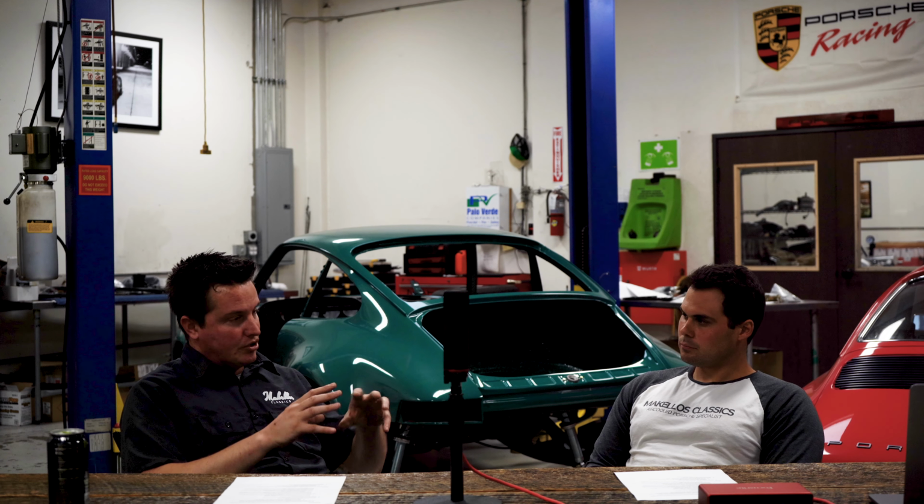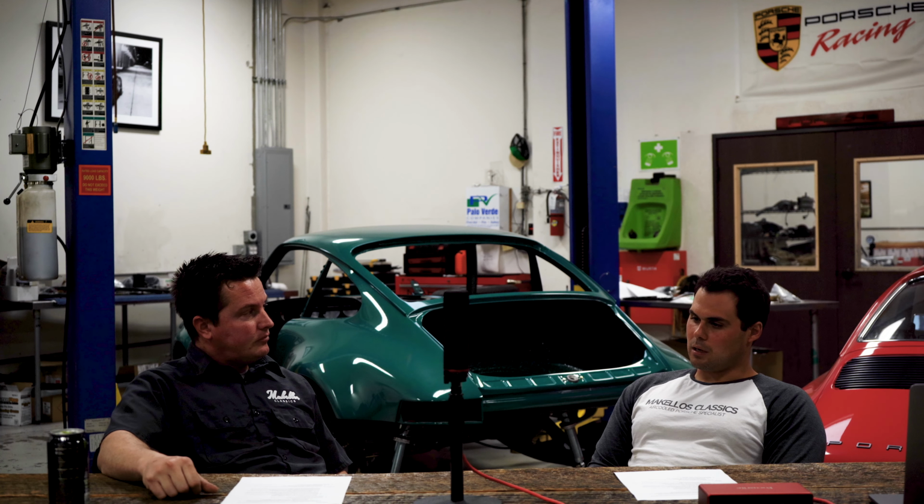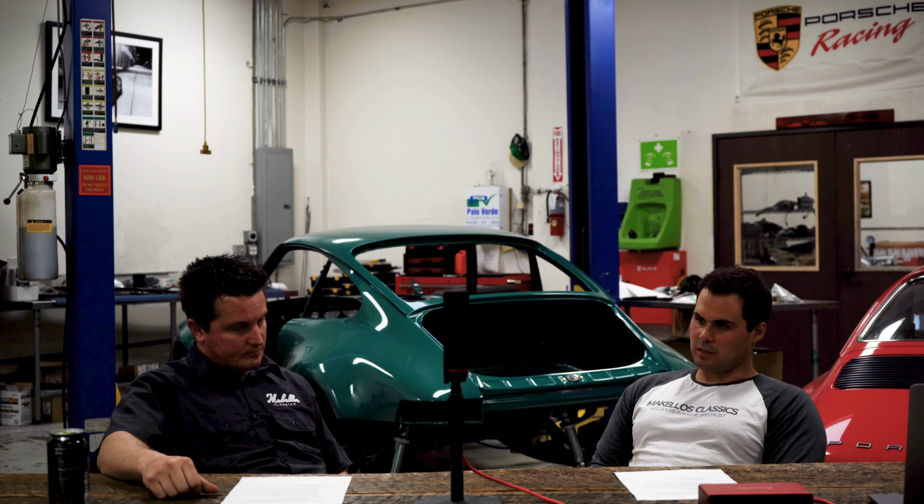So deflection is how these pivot points are working. Are they working precisely? Or are they just going to move around a bit? And then the friction, whether it's actually in the bushing sleeve going to try and grab or pinch. And so we rarely do rubber. We tend to like to move over to polygraphite, the next level up. That is my favorite, I believe, and it really just improves the handling, and it doesn't make it too stiff either. It's a good in between.